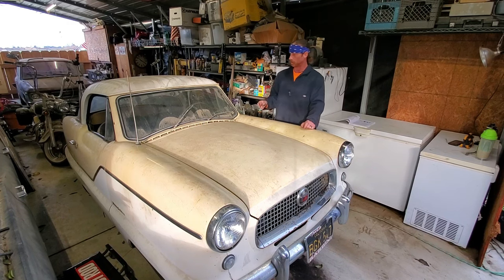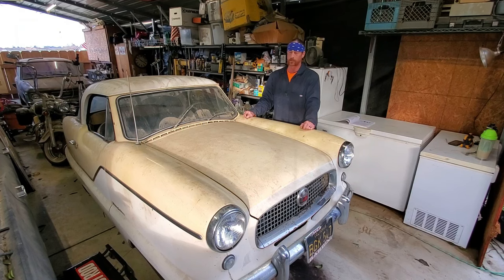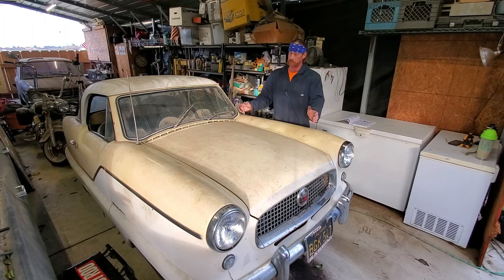And then also, I'm going to dig into the master cylinder for the transmission, for the clutch, and the slave cylinder and see what's going on there, see if we can get them opened up, see if we've got fluid, and see if we can maybe possibly get lucky and they work if we add some fluid or bleed them or whatever.